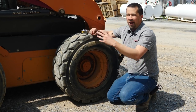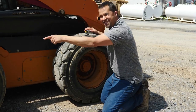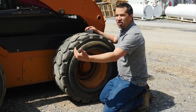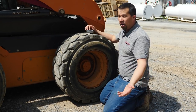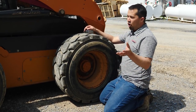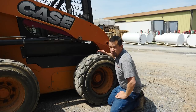It could put a lot of wear and tear back onto that driveline. The other thing that will happen is that force still has to happen. If this tire needs to roll 48 inches forward and this one needs to roll 46 inches forward, that extra two inches is going to come from somewhere, and it's going to result in one of the two tires dragging as you drive forward. That's going to result in premature wear of maybe your good tire, maybe the old one — who knows which one is going to get better traction — but one way or the other, it's going to cause premature wear as the driveline forces that tire to slip as it rolls forward.